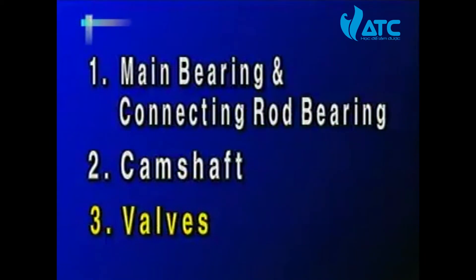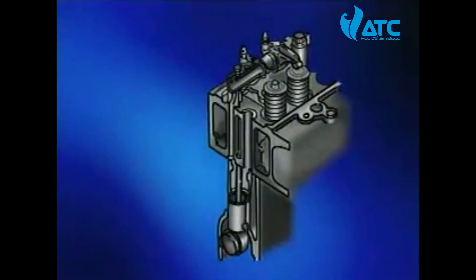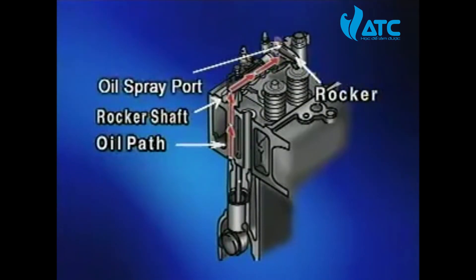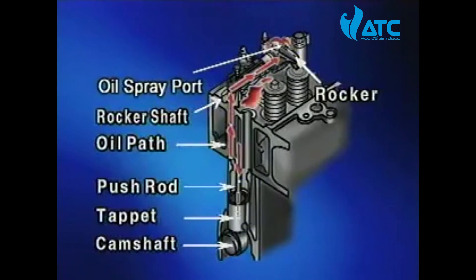Third, valves: the engine oil flows into the cylinder head through the oil hole and the pipe at the upper part of the crankcase. After lubricating the number one camshaft bush, the engine oil lubricates each rocker bush flowing in the rocker shaft through the front rocker shaft bracket. It lubricates the slippery surface of the valve cap at the rocker and valve stem, being sprinkled through the oil hole at the upper part of the rocker. It also lubricates the tappet and the cam of the camshaft, flowing back to the oil pan through the cylinder head and the push rod hole in the crankcase.